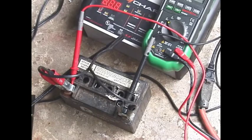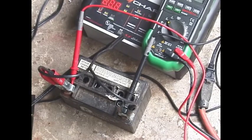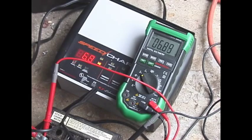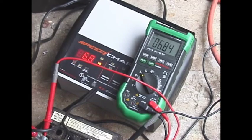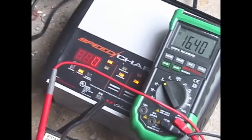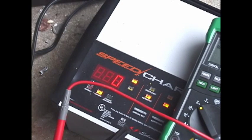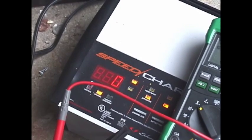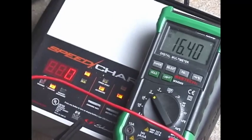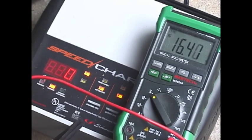Once you put it in this mode for about 3 or 4 minutes, the battery should come up to past 4 volts and be able to be charged normally. You'll see it shows it's at 6.8 volts now. We can see it's showing it's at 0%. It's been sitting for two years, sulfated, and it had half a volt on it when I first hooked up the voltmeter. But putting a slight charge on it boosted it up to 4 volts.